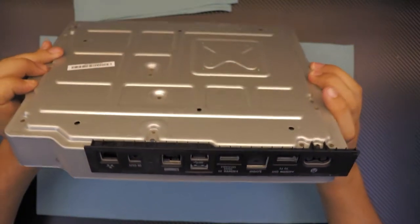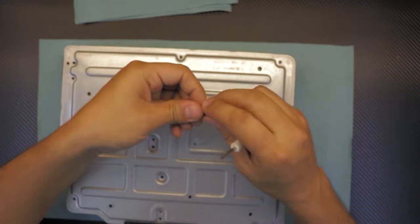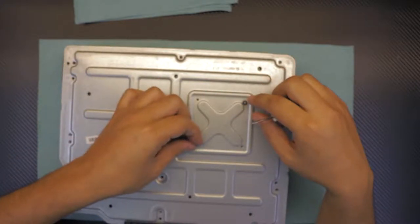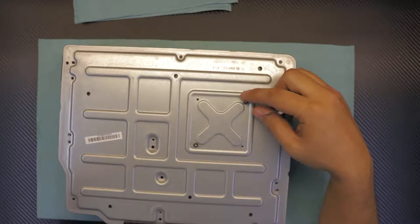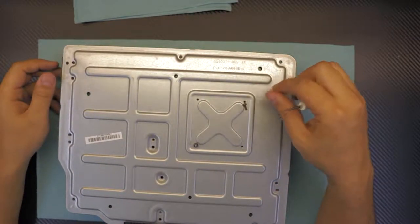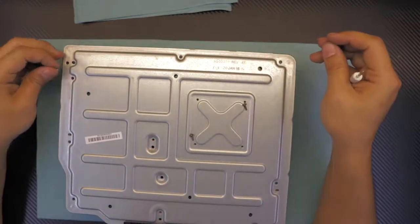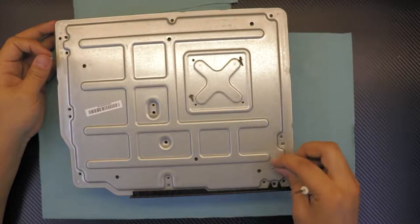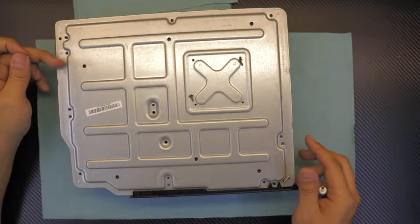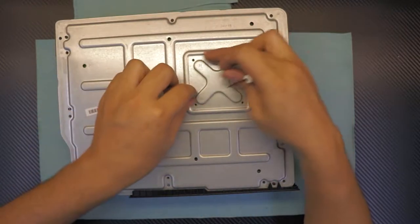Next, flip it over. Once flipped, you'll see a few screws — there are four screws right on the cross which holds the heat sink, so go ahead and remove those four screws. You'll also need to remove about four screws labeled B4, B2, B3, and B1 starting from the two corners. So there are four screws along the side and four on the cross.